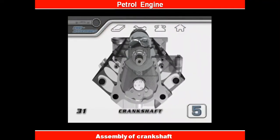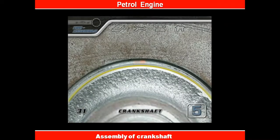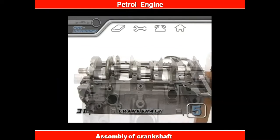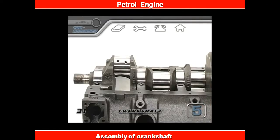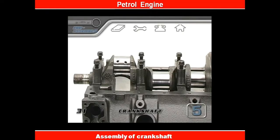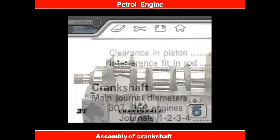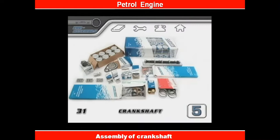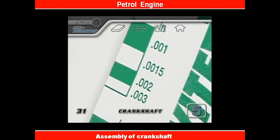Next up is a critical measurement. We need to check the actual clearance between the crank journals and the bearings. Right now we're only going to deal with these three main journals. Make sure the crank throws — which are these parts of the crankshaft — are out of the way so that your crank sits in like this. That will allow us to install these three main caps with our checking tool and still be able to tap on the bolts to remove the caps without possibly disturbing or rotating the crank. Usually you can look up the main bearing clearance specs in your repair manual. Clevite supplies green plastic gauge with all of their engine kits — it measures from one to three thousandths of an inch clearance.